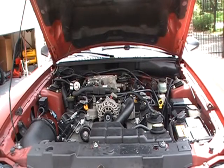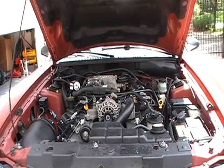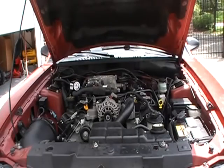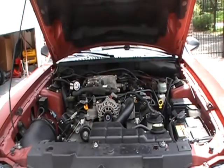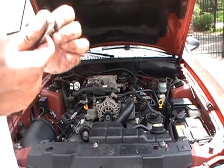I'm going to wash all this with pressure. Make sure everything is clean so nothing falls into the spark plug hole. The next step is to unplug the coil plugs. You need a 7mm socket and a ratchet.